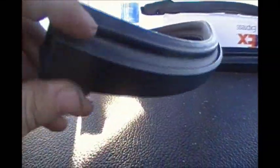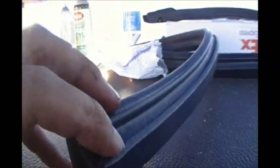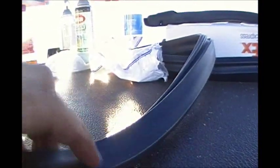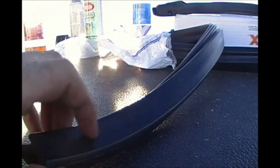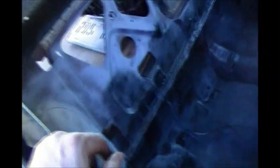Here's the reproduction from Original Parts Group — surprisingly it fit pretty well. This is the part I was talking about: put a thin bead of weather stripping adhesive on it and it just pops in, following this channel all the way back into the quarter panel, about three inches or so. There's a little left over — I trim mine off, but you don't have to. I need to do that before I can put the door panel on this side.